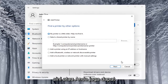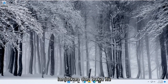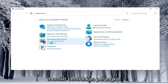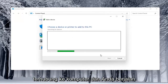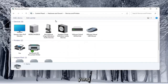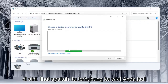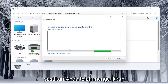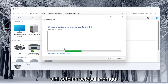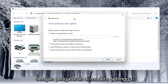You can walk through these steps right here. Alternatively, you can also open up the start menu and type in control panel. Best match will come back with control panel — go ahead and open that up. Select view by and select category view. Underneath hardware and sound, you would select add a device. Again, you'd see if anything is connected to the computer and walk through those steps. If you open up hardware and sound and then select underneath devices and printers, you can select add a printer as well. This will check if it connects to your Wi-Fi, so make sure your printer is turned on, and if it is a wireless printer, make sure you've typed in your Wi-Fi credentials into the printer itself so it's connected to your network. If it doesn't populate in the list once it's done loading, you can select that the printer I want isn't listed, which opens up the same dialog screen that we saw back with the modern UI settings.